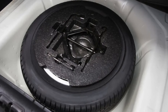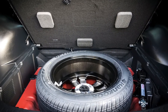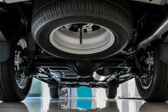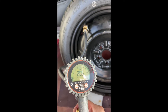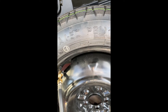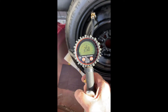As you know, if you have ever taken a look at your spare tire, it's not nearly as easy to check as the four mounted tires, since it's under a cover in the trunk or underneath the car, and is usually secured upside down, so you have to actually remove it from the car to get to the valve to check it. Spare tires usually require a much higher inflation pressure — all three of mine require 60 PSI instead of the normal 35 to 40. This pressure must be maintained if the tire is going to do you any good in the event of a flat.